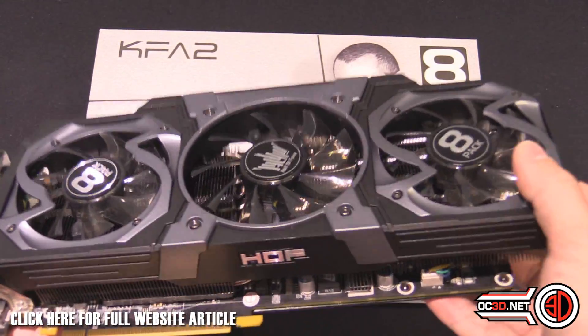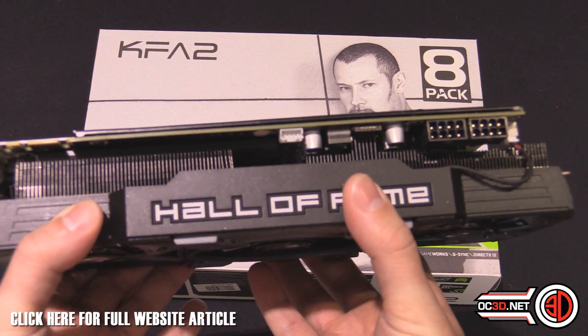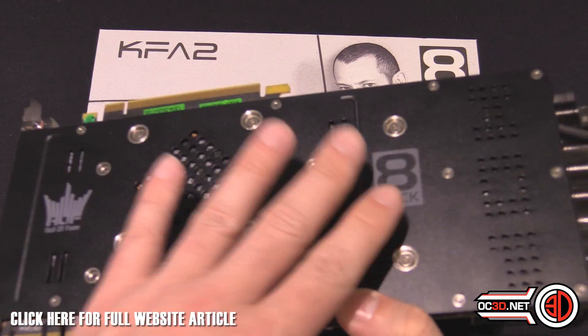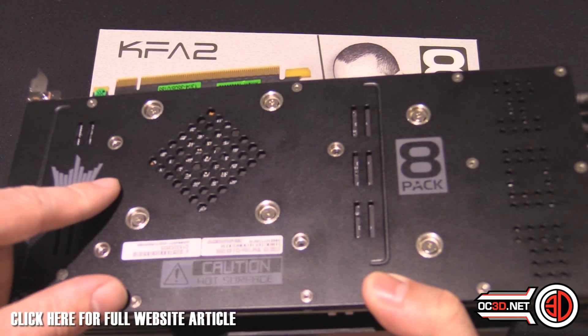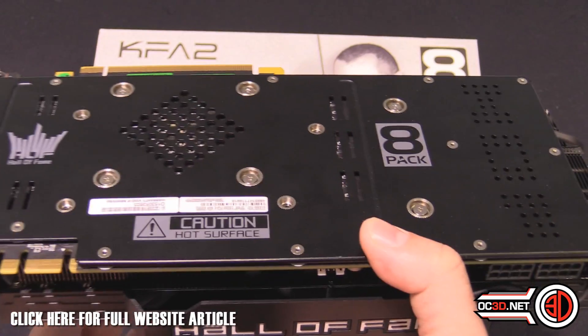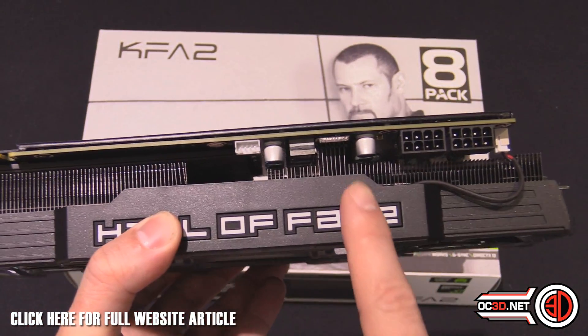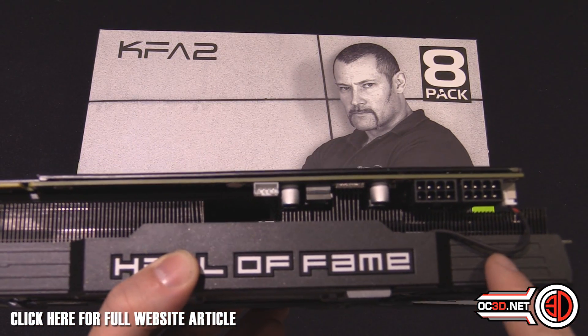As I've said, it's not all just a color change — you'd be very misled to have thought that. Although we've got a nice black backplate on it now, the PCB on this is actually wider, and that's so that the signals between everything can be kept cleaner and allow better overclocks. But also look at this — the MOSFET heatsink is actually attached to the main heatsink body.